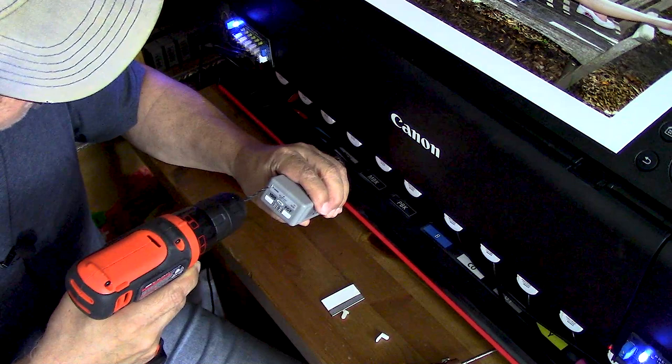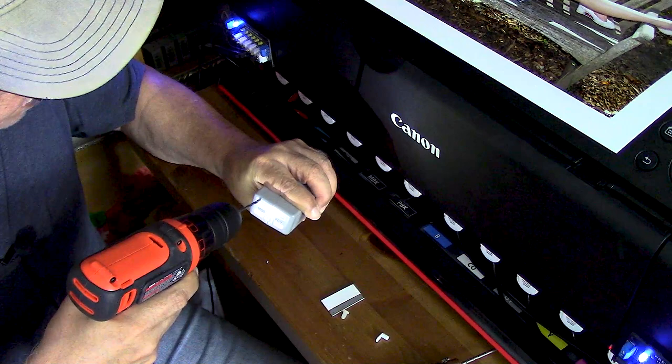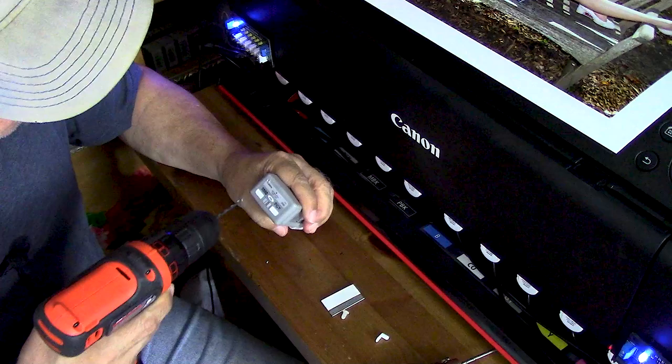We're going to go ahead and press in. Finish drilling that pilot hole. As you see, a little chip just fell out. By the way, these are reverse helix drills, so they're going to pull the chips out, actually. So don't worry too much about that. So let's take a look at our progress. Okay, we're making a nice depression. And again, I'm doing this super, super slow for you guys.